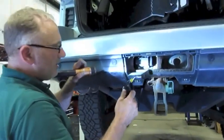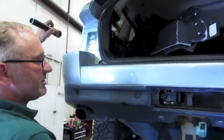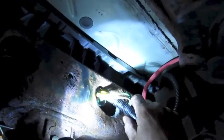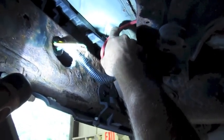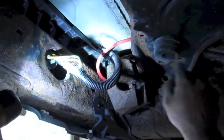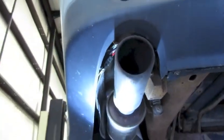The next process is to route the pigtail harness from the connector up behind the bumper to where the rear tail lamp assembly is. The pigtail harness is out of the back of the rear bumper reinforcement, located through the top of the bumper area. There is also a red cable — this is an aftermarket cable put in by the owner of the vehicle; it follows the same route as the trailer harness but is not part of it. The harness goes over the weights for harmonic noise, over the other side, and up underneath the tailpipe — this is where it came out — routing right up following where the rear tail light comes out.